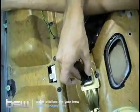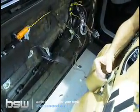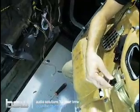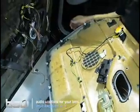and this will just work itself off like that. So you're going to rock the door panel off of this little plastic clip. So the door panel will go boop, and this will remain here on the metal. So you're just gonna have to rock the door panel, and this will just ultimately rock free and then come off like so. So this car came off. If you've got an older car, it's probably gonna pop off. If it's a newer car, you'll have to rock it.